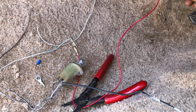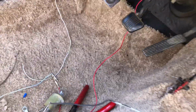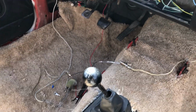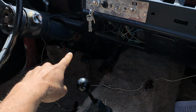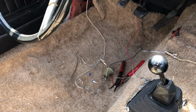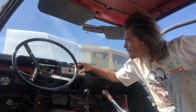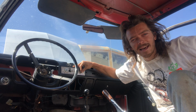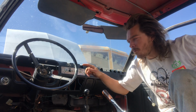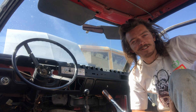Oh! Oh, wow. Okay, it wasn't working. It wasn't working, so there was probably, I guess, some oxidation on the brake switch, and we managed to break it free. So we got all of our switches set up. We got the fuel pump, the headlight, and the brake light tail light. The brake light tail light is hooked together, like I mentioned before. One goes on to the brake switch and the other just goes all the way back to your tail lights.